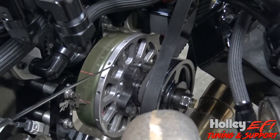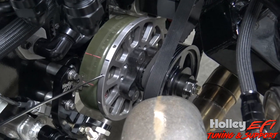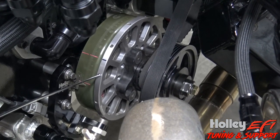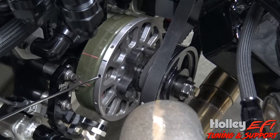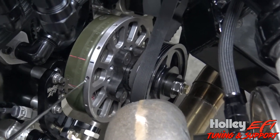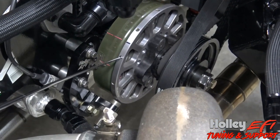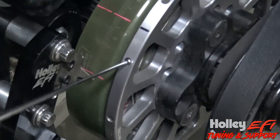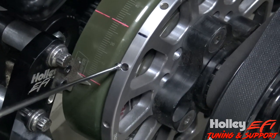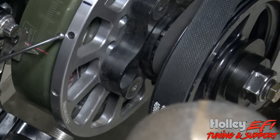So the wheel ships with 12 magnets in it. You take a roll pin punch and smack it out. When you knock them out, they go from the outside in, so you don't have to do anything trying to press them from the inside out — they press in from the outside in. It takes a little bit of effort, but put them in a soft jaw on a vise and give them a couple of good taps and they come out. So this is the 12 minus one.